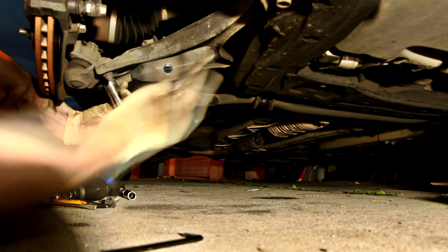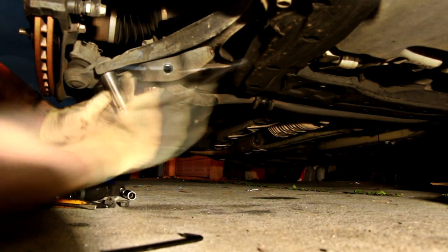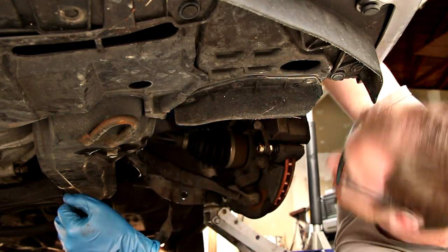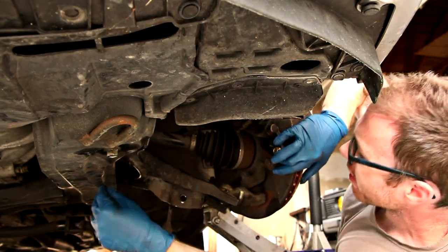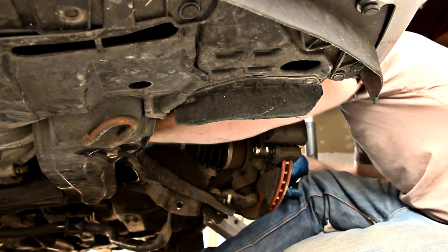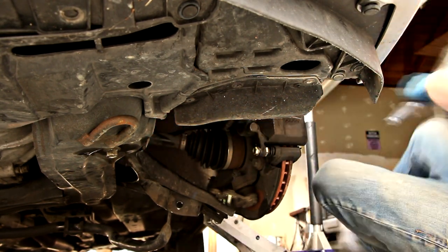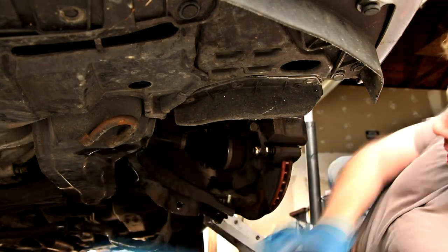Next up, you're going to have to remove your ball joint fasteners to separate the knuckle assembly from the control arm — there are three 17 millimeter nuts here. My camera battery died here, so I filmed myself doing the next steps the next day on the other side of the car. The control arm is bolted to the chassis with two bolts: a 14 millimeter beneath the axle that points towards the back of the car, and a 17 millimeter that points up. Remove them both, then wiggle the control arm out of the car. The first time you do this, it's going to take quite a bit of wrangling.